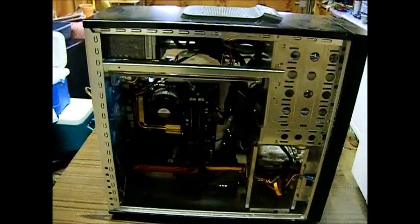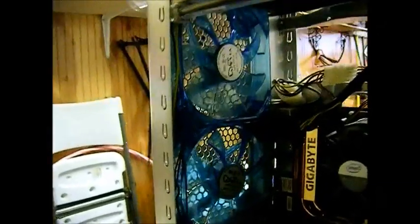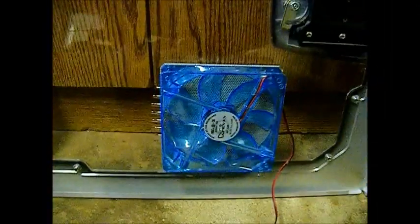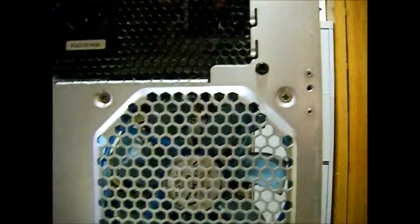At this point you want to remove all the fans. My case has two fans here; yours might have one or more depending on what kind of case you have. I'm also going to remove the one on the door. They all remove pretty much the same way. The ones on the case usually have four Phillips screws on them — just grab the screwdriver and remove those and we'll be ready to go.